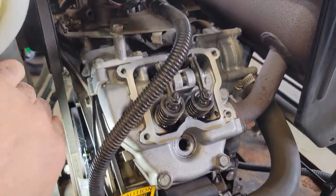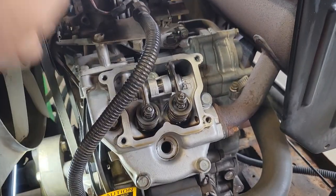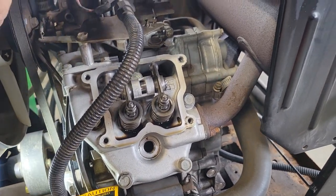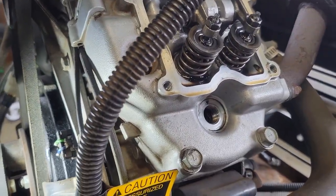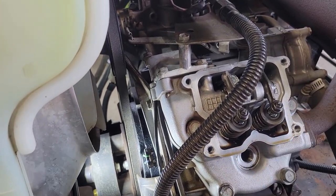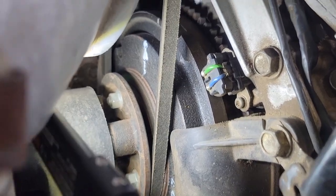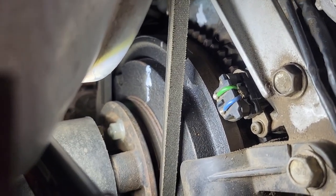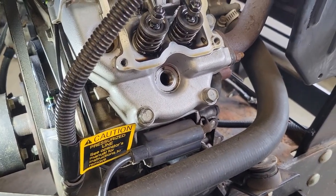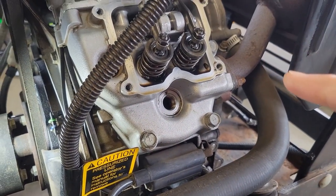As we rotate, you're going to see the valves open and close. That's opening — here it comes back up on the compression. When both valves are not moving, usually you'd be near the top. So how do you know? You put something in there. I can see it's way up at the top already. I've got to keep turning until that is the number 1. That looks to be lined up at the top — way at the top, that's great.